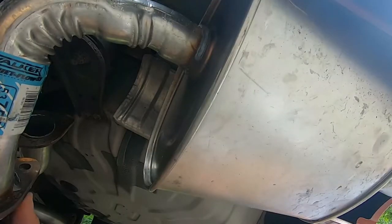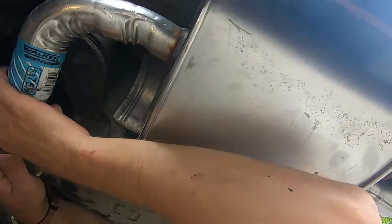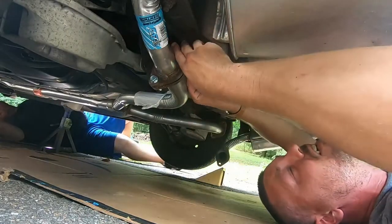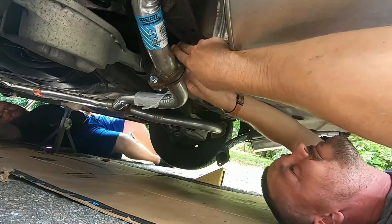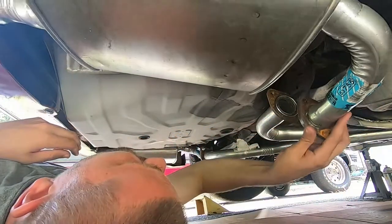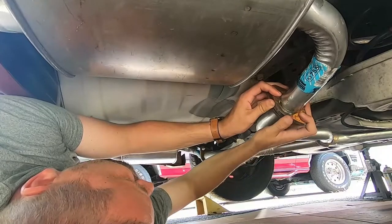Now this is one of the mufflers — Bob is installing the driver's side. Those rings go around and as you tighten it down, the rings compress to help seal all the way around the exhaust so nothing leaks out. Here we are tag-teaming: I'm still tightening up the bolts between the down pipe and the resonator assembly while Bob does the other side — same deal, ring gasket in place, bolts in. That's really all there is to this exhaust: a bunch of bolts, loosening and tightening, a couple of hacksaw cuts, but pretty manageable.